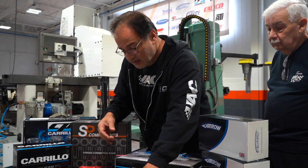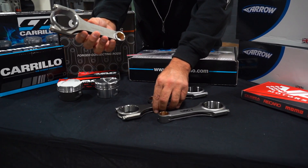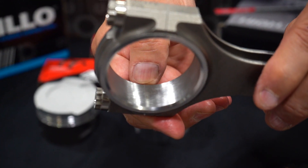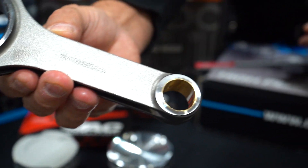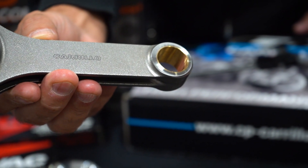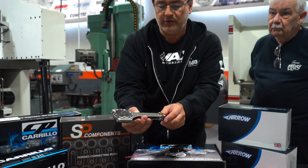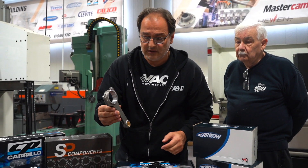When you look at a honed finish — talking about Carrillo here — you can see the parting seam after the honing, not the end of the world. You can also see the honed finish on the pin bushing side. As we discussed in the previous video, the right way to measure connecting rods is on a Sunnen gauge designed for rod measuring, squaring up the face on both small and big end to get accurate dimensions.